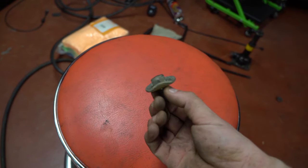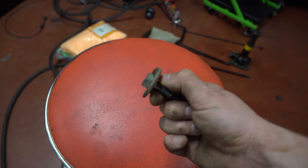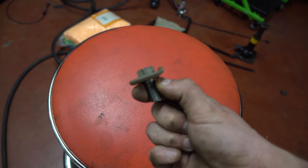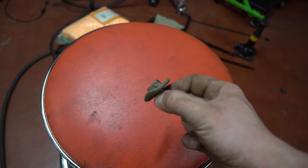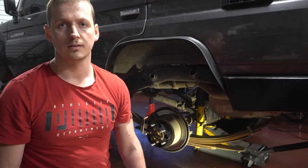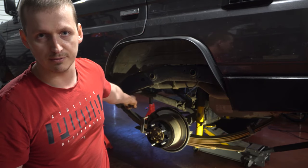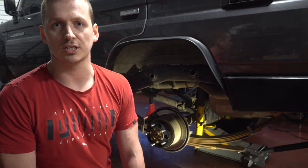I should point out that with these U-bolt plates it's not all advantages. What happens is the shock then becomes the lowest part of the vehicle, and instead of hitting the U-bolt plate you end up hitting the bottom of the shock. You can see it has rounded over the washer nicely, and over an extended period of time this could cause problems with your shock. To remove the leaf spring, I find it easier to take out the shackle end first, which allows it to pivot down at the front. If you reverse this process when assembling, it makes life much easier.